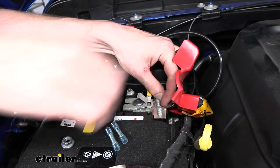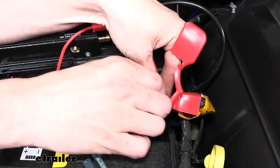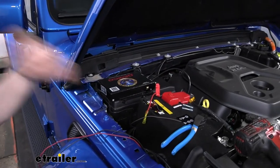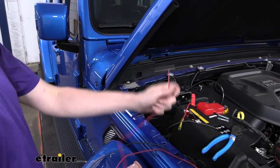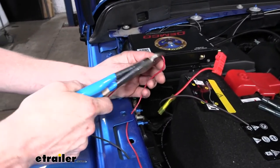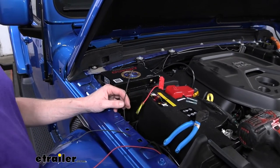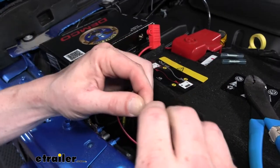After the nut is loose, hold the plate in place, slide your harness ring terminal onto that post, and reinstall the nut. On the other side of the fuse harness, the red extension wire from the orange wire on the breakaway switch connects there — trim it to a reasonable length. We're also routing a good amount of brown wire from the kit inside to power up internal components, so hook this to here as well, stripping each one back and twisting them together to go inside the butt connector.